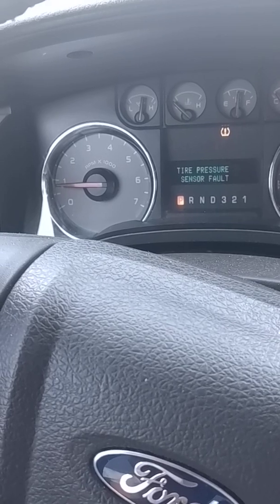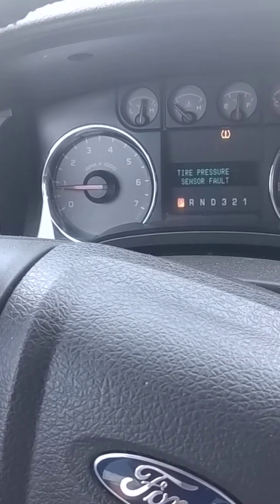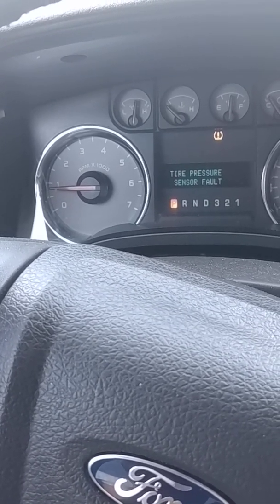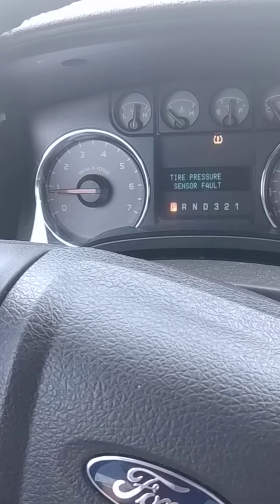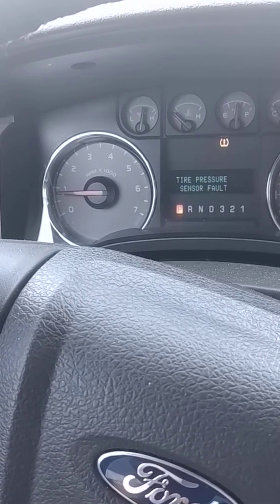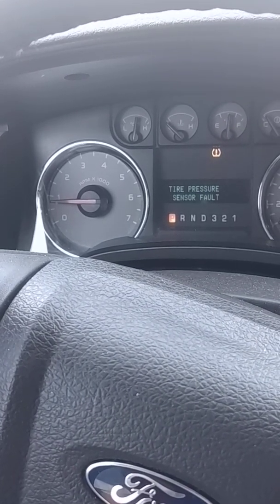Because it idles and runs perfectly all day. It's just that startup in the morning. So my thought about the spark plugs was because I put a liberal amount of anti-seize on, I was wondering if it was heating up and then dripping down onto the electrode, causing misfiring. But I don't believe so, because it wouldn't run fine all day like this.